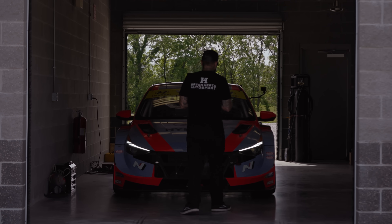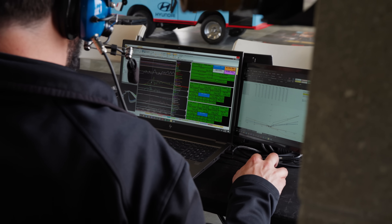Right there, you're asking for 45, but it doesn't actually get it to you until this point. And what's the time on that? From the roll-in, it's 90 milliseconds. But I feel like sometimes I go in really hot, and I'm like, that was weird. And then the next time, I'll be over-slowed, and I feel like I did virtually the same squeeze.